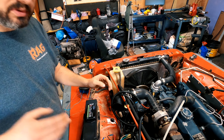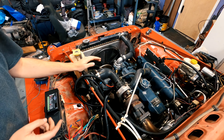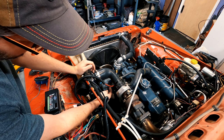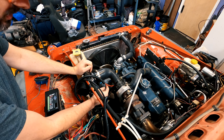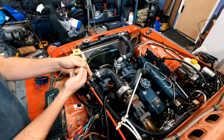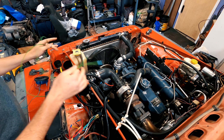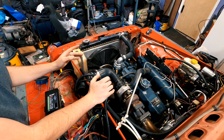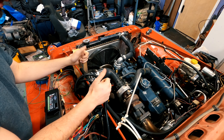The way we're going to do this: we have to take the back plate off the alternator. We'll need to remove the charging cable, move the two wires, remove a couple of nuts, pull the back plate off — and then it has a piece sitting underneath where we can hook a wire to it. This should give us a signal. I don't know if it's going to be accurate, and that kind of doesn't matter. All I need to do is see if I can pick up a signal that registers on the tachometer, and when I give the engine some RPM, if it changes, then we're good.